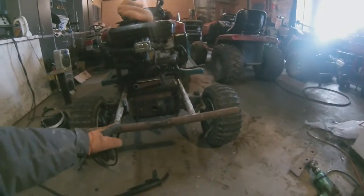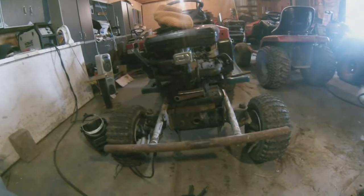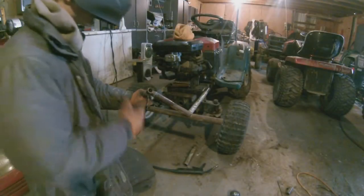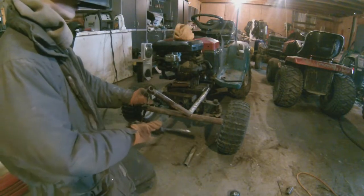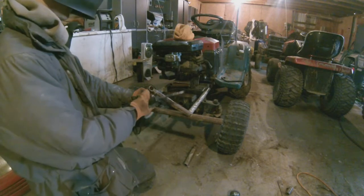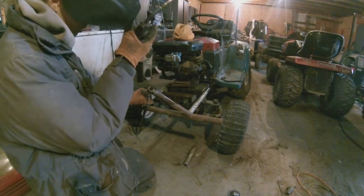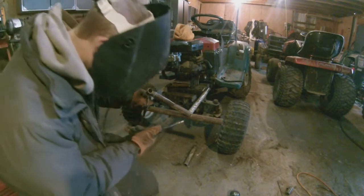Now I'm going to cut out a corner of a pipe real quick because I'm going to have a little point coming out from here to help shove stuff down. I don't want to keep too much of an angle because I do like to ram into stuff — sticking out too much and I'll probably just bend stuff, so it's got to be strong. I'm going to put this in at an angle so it'll help me shove up little ledges I just can't get my front tires over, which is better than a flat bumper. It'll help slide stuff upward and shove brush with a triangle point toward where it'll go under the tires instead of under the frame.